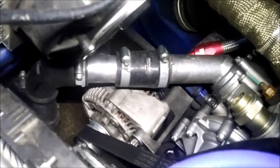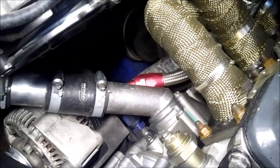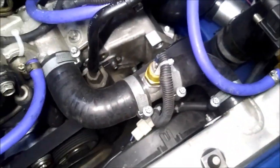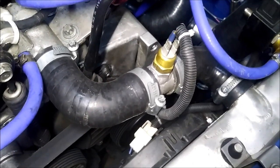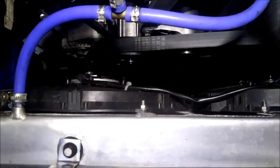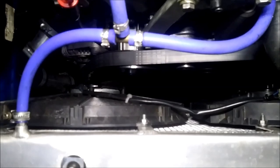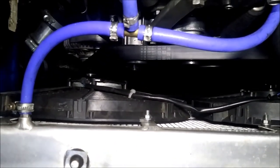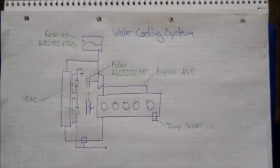The line goes from the bottom of the radiator to the pump. There you can see part of the cooling modification — there's a dash fitting behind the pump inlet and a hose going to the back of the block. There's the inlet for the radiator with the temperature switch which switches on the electrical fans. It's normally a good idea to keep the original visco fan, but I had space issues so I needed to use the electrical fans. The cooling power is not nearly as good as the visco fan, but I don't have a choice here. That's it on the water cooling system.